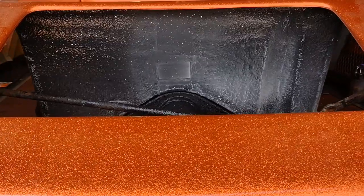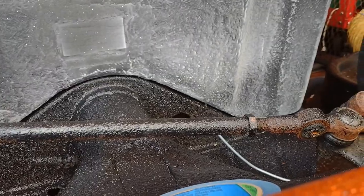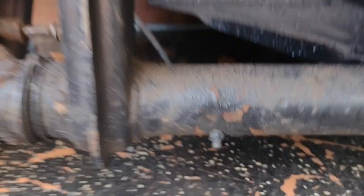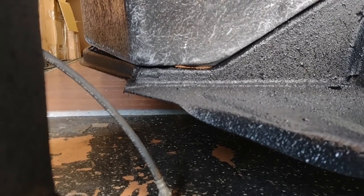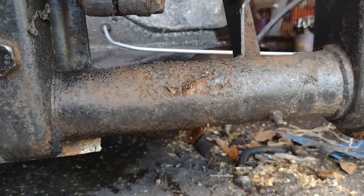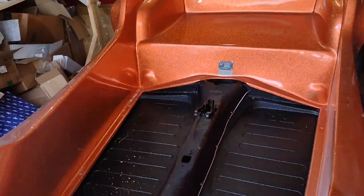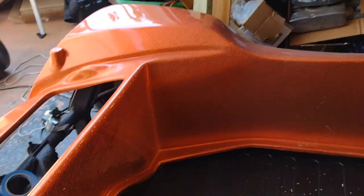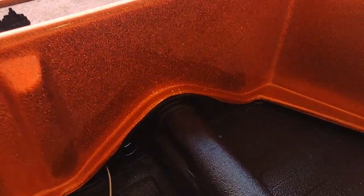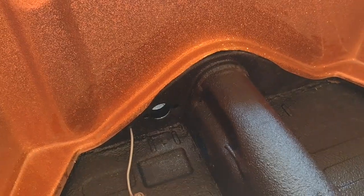After several times taking it on and taking it off, we got it to sit down there — that's pretty darn good. See down through here, minimum of a gap. The sides of the floor pans will pull up when we start putting bolts in, but the gasket should seal all that up. And I didn't butcher up the body too bad, which is what I was really concerned about — cutting too much. I had to cut from here all the way over to about the same area on the other side, but that's what you've got to do.